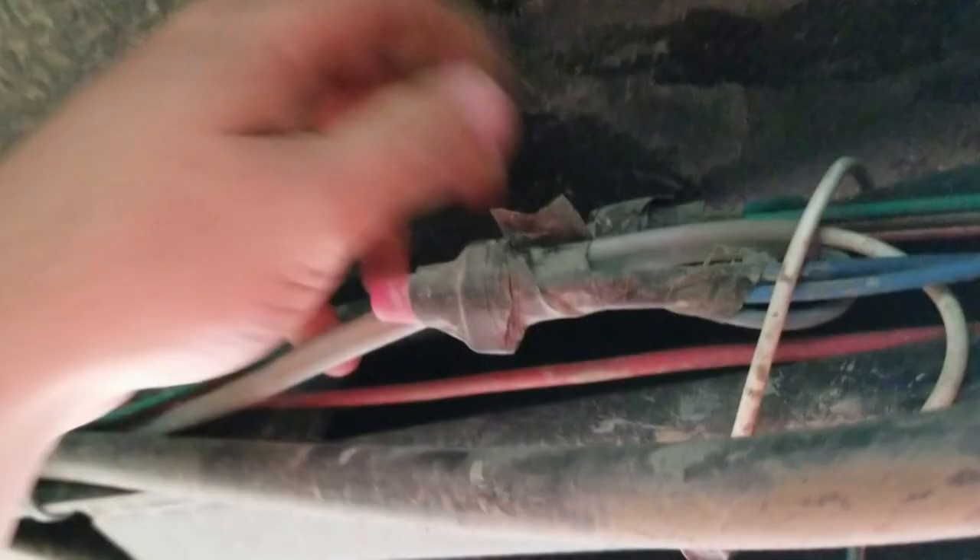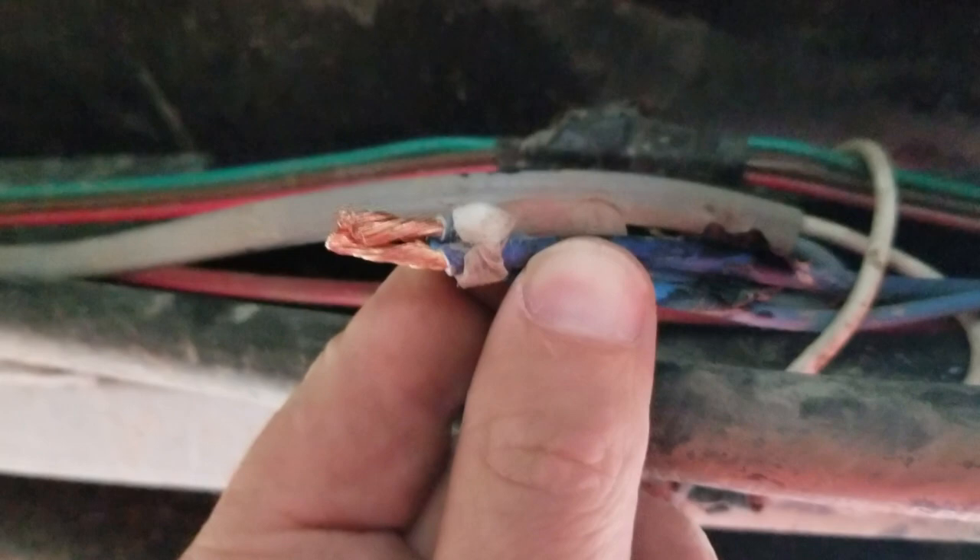Along the frame rail, over to in here. Of course — that doesn't look like a Marette. She looks pretty fresh, not too much green death. But you'll notice they're not connected — they didn't get twisted together proper in the Marette. Now here's the real problem: we got a glob of sticky glue and the wire worn right through.